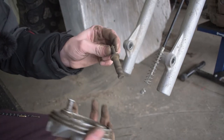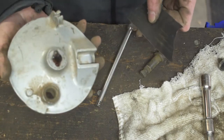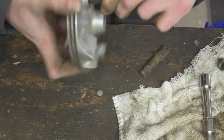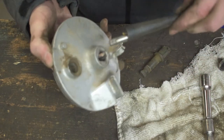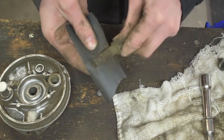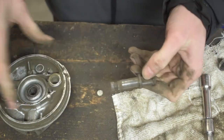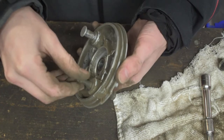If you guys have learned something new make sure you click like and subscribe. Now let's clean this up. I've cut up some 220 grit sandpaper and I'm going to wrap it around an extension to make it nice and skinny, then stick it inside where the brake was and sand it up. It's now nice and shiny inside — exactly what you want. Then take that sandpaper and sand down the barrel piece as well. Now it's nice and smooth, metal is visible again, no more rust. And now it turns like absolute butter compared to before when it was crunchy and gross.